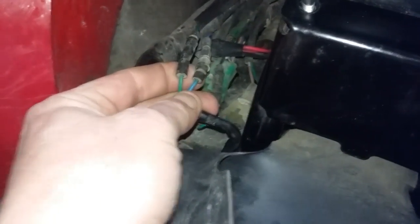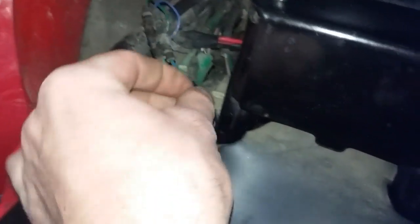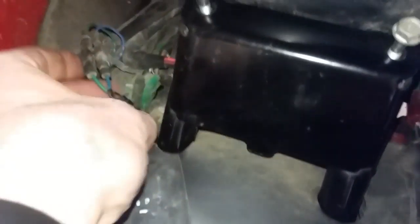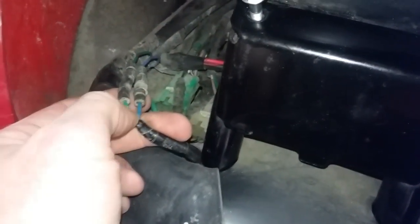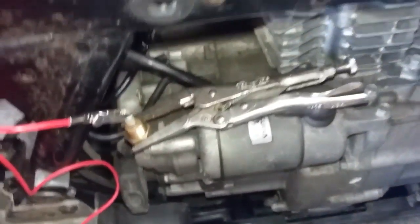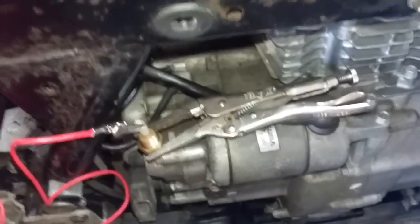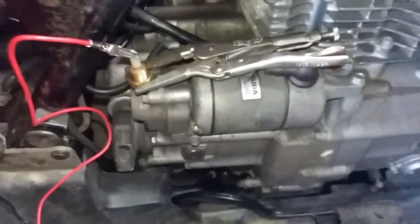If you're looking for the fan wires, obviously you'd have to remove the gas tank, and underneath this little flap are your two wires — a blue and a green. Those drop straight down to the fan right here. If you were to take a battery with two little jumper wires, you could put power straight to the side that goes to the fan and test it. It's pretty simple — if the fan kicks on, well, you know your problem is elsewhere, whether it's the temp sensor, the fan control module, a broken wire, or something else.